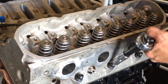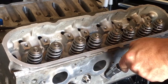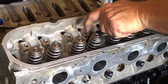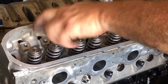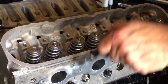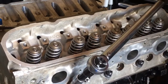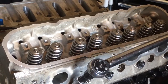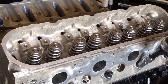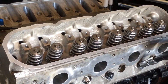All right, let's get the 50 pound torque. This is where you'll start sweating it a little — it takes quite a bit of turning to get where you want to be. Nice even strokes. Don't go back and forth loading and unloading your torque wrench; use nice even pressure until it gives. I see a lot of people doing those herky-jerky motions on their torque wrenches, and that can give you some pretty erratic torque readings.